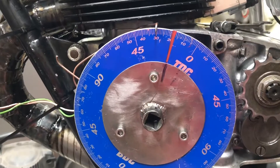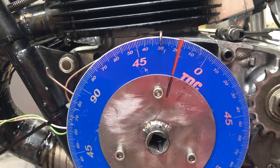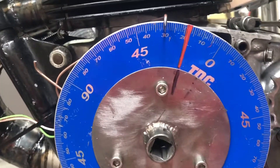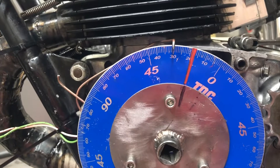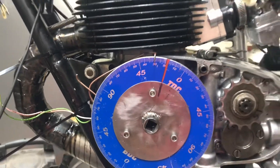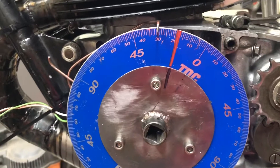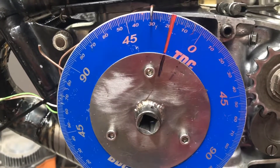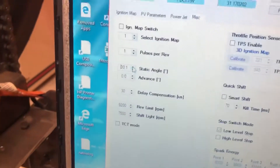As you can see, we were off about 10 degrees before top dead center. We're going to make an adjustment because I think what we have going on is a polarity issue. I'm not going to change that right now — we're going to creep up on this first.